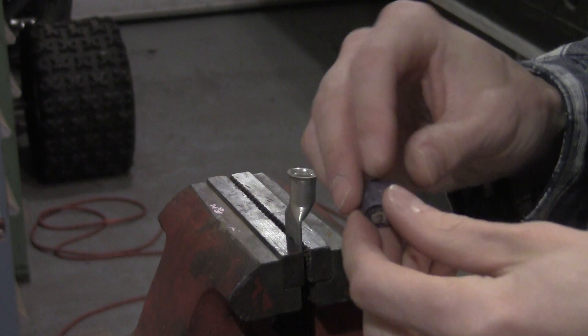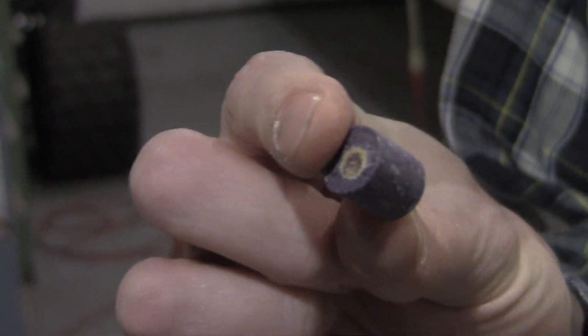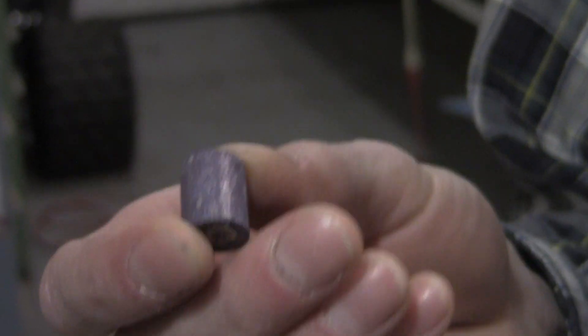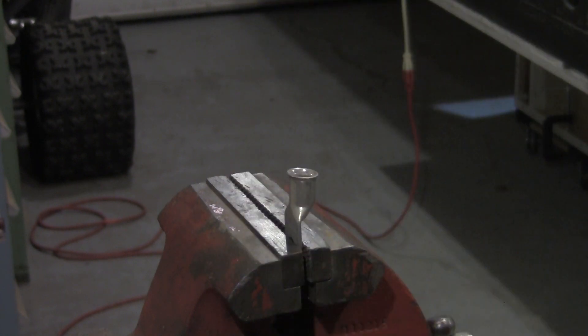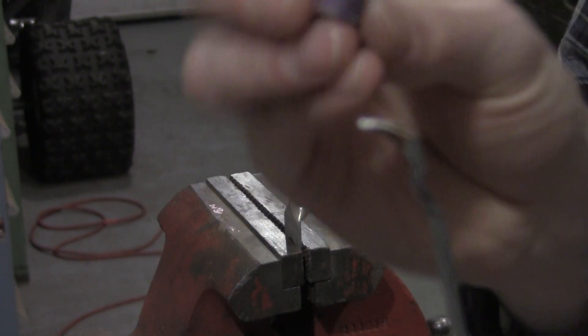We're making the battery cables my homemade way. These are solder slugs with lead and flux built in. These are 2-aught cable fittings, but these are for 3-aught - that's all I had - so I cut them in half, giving me two of them, and I'll just add a little extra solder in there.